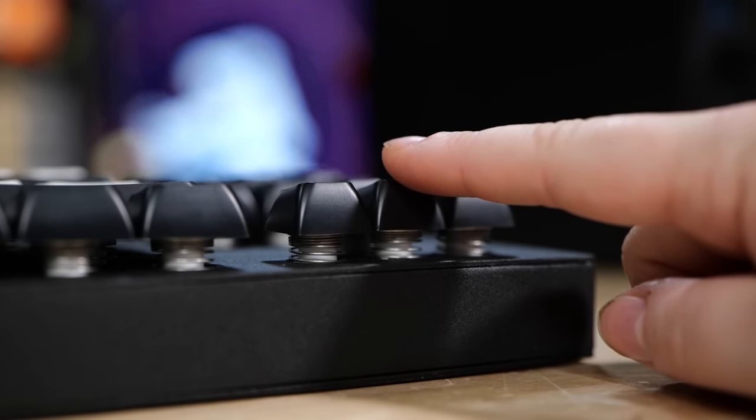Even hitting the key really, really rapidly, you're not going to encounter this. It's only when you've held the key down for a very long time. It sticks for maybe another 200 milliseconds. We'll get some high-speed footage, you can see exactly there. It's probably less than 200 milliseconds, but it does stick for just a moment. And the amount of time that the key sticks varies from key to key, even though these are exactingly, lovingly manufactured. It's not gonna be a zero hang time. It's gonna hang for a second in the depressed configuration, which was something the original beam spring keyboards that I have do too, even with their metal beams and all of the other stuff that's in those ancient switches. So for better or worse, that's how it's designed to work.